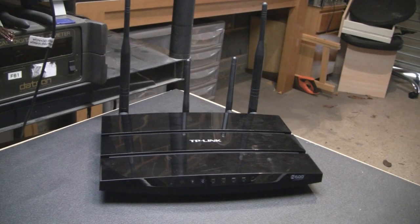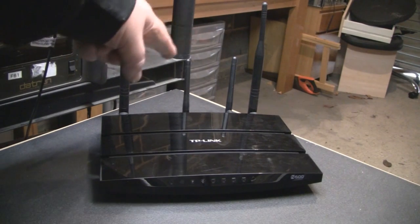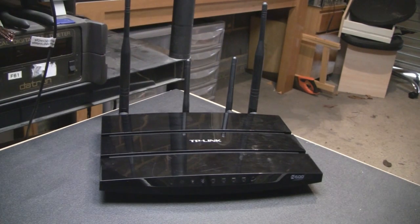I hope you found that video useful and it demonstrated how much a signal can be improved by using a proper dedicated antenna tuned to that particular frequency. The 5GHz went from 20% up to 80%, and these two 5GHz antennas are only very small ones at 2.5 dBi — so I could even put some slightly bigger ones on there and maybe get it up to about 90%. I hope you enjoyed that video and got something out of it — if you did, please give it a thumbs up and hopefully you'll join me on the next one.